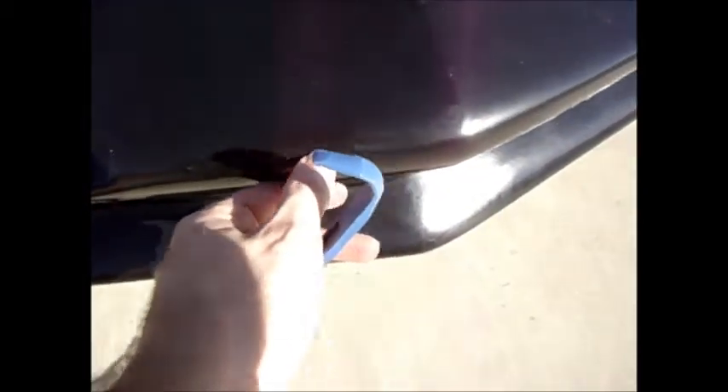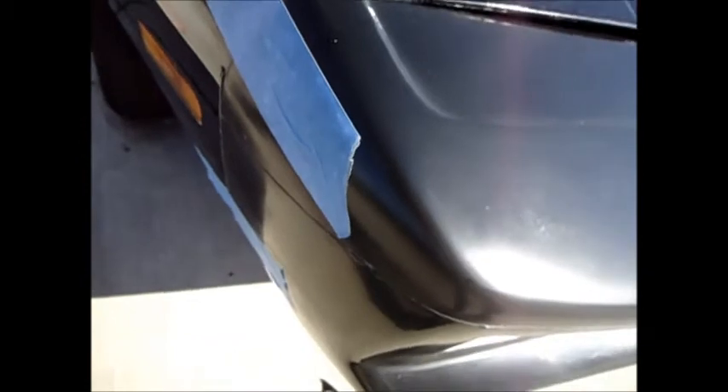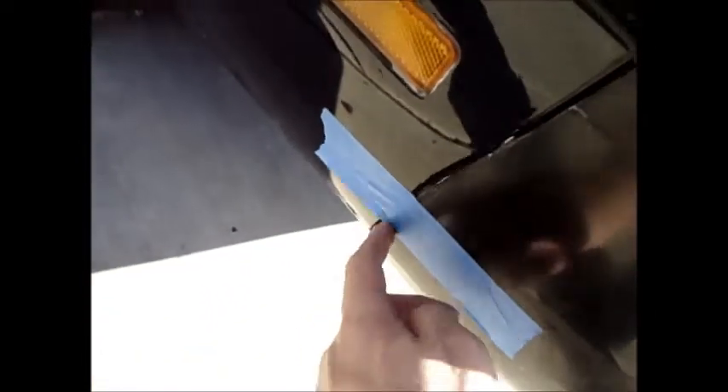The whole bumper — that's pretty much the only one I found — but there's still probably little pinholes and other imperfections that need filling. Always sand down the seam line, and sometimes you find imperfections there, sometimes on the edge. Make sure you guys do that when you get an aftermarket part.